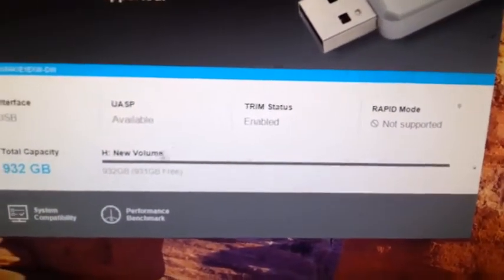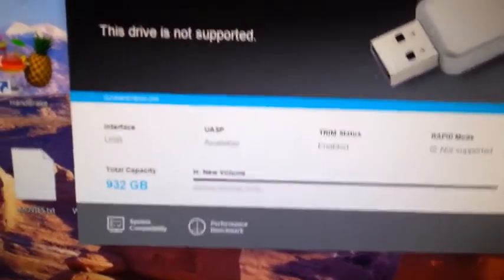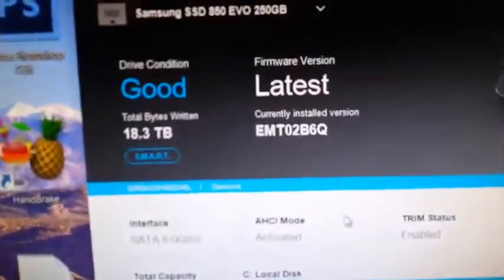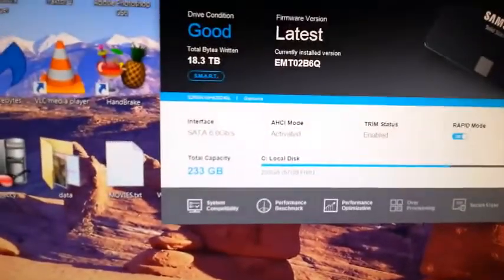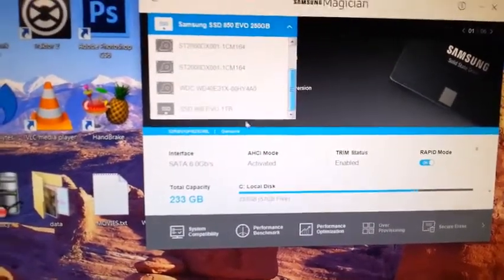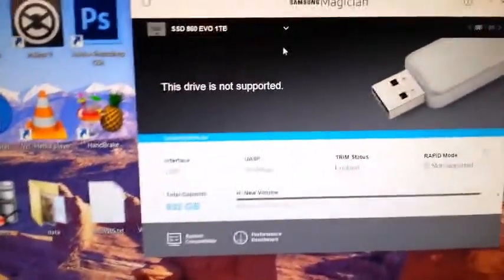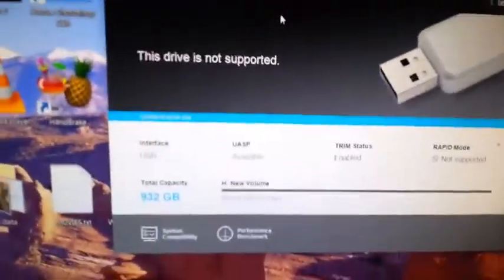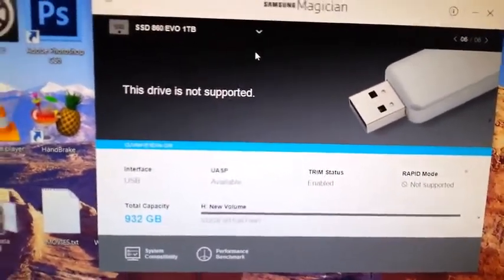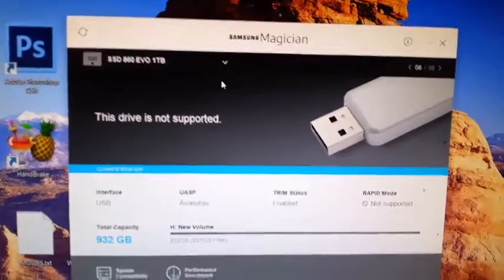It's just being recognized through Disk Management and My Computer — nothingness. If we go to my original drive, I have an 850 as primary — that's running perfect and it's good to go. This one I just bought is not good. That is the 860 EVO one terabyte, not recognized by their software. It did allow me to do a benchmark, but the benchmarks are very low — not even close to what an HDD does. For $167, it's either a damaged or counterfeit hard drive, so it's going back.